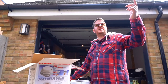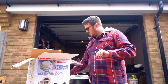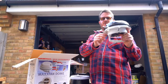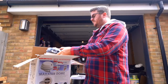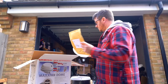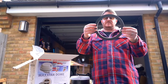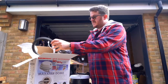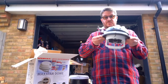Because the roof on the Crafter has ridges in it, if the fan falls on one of those ridges it's really hard to get it secure — you have to pack it out with silicone or bitumen tape. Thankfully I found someone on Facebook — North Devon Campervans — who makes 3D printed adapters. They're really cool: the fan fits perfectly inside the adapter, and it has little ridges that fit perfectly on top of the van's roof.